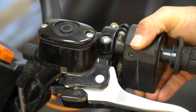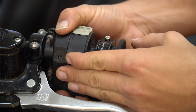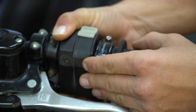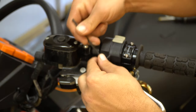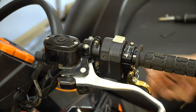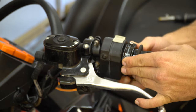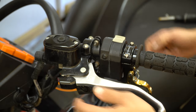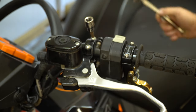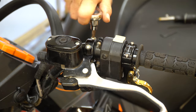Now that all this stuff is loose, you simply push it over. Just before this is tight, I'm going to go ahead and pull my switches back over and tighten them up, then re-tighten my brake lever. No need to over-torque that set screw. Make sure that you put your little piece back in — you don't want mud packing in there. During this process, because it better suits my needs, I'm going to go ahead and move the winch controller to the other side of the brake lever.